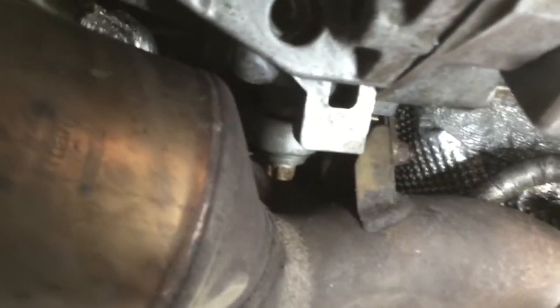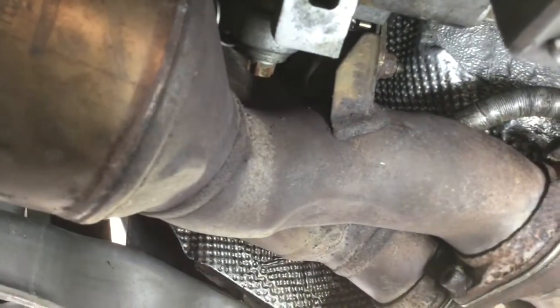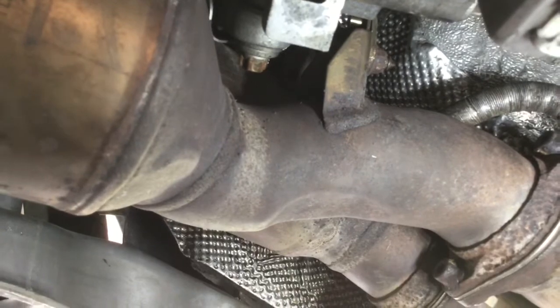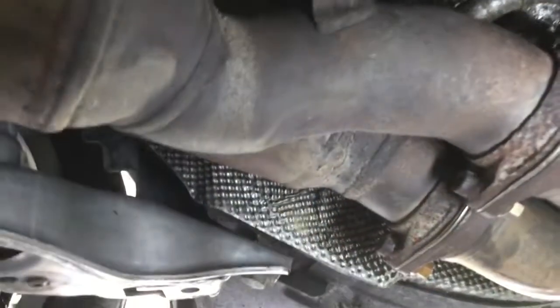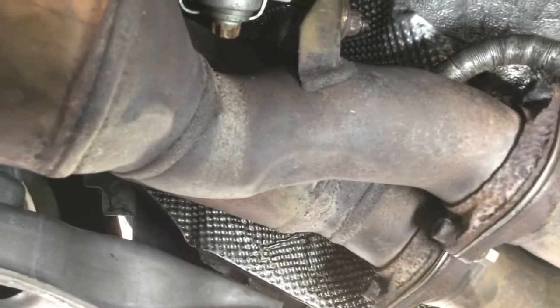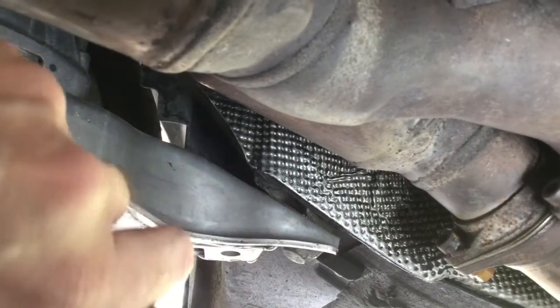In the process of fixing this oxygen sensor problem. I'm under the car. This is the pipe that goes up front for cylinders one, two, three. This is the pre-catalysis. The oxygen sensor was here, connecting from above like that. I was lucky enough that it was loose to remove it — so maybe this is why it broke. Maybe with the vibration, the element on it broke.